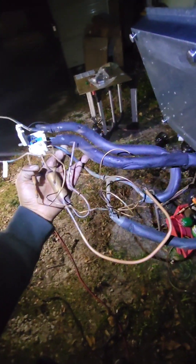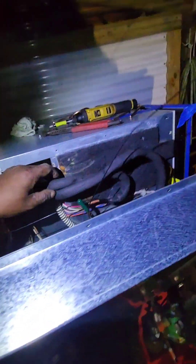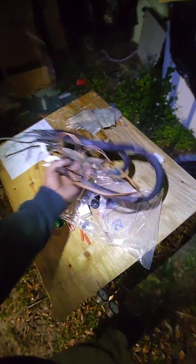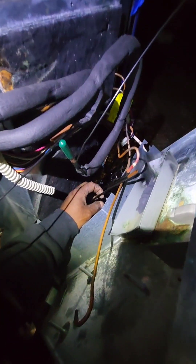I just got the old heat exchanger assembly out with the three-way valve. I repaired the drain pan with that magic sealant I showed you guys earlier. I got the new heat exchanger and I was bending it into place in the same form and shape as the old one — that's why I try to keep it intact; it makes it much easier. I got the new condenser assembly in, just got to solder in the other port.